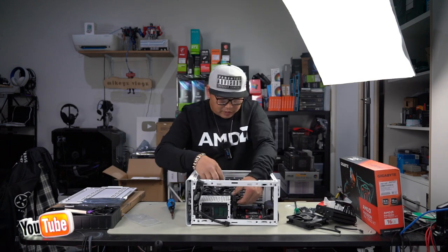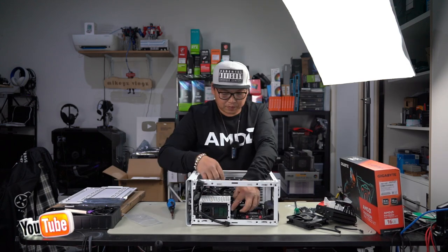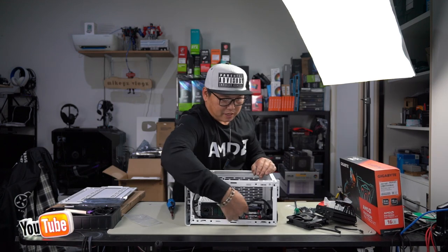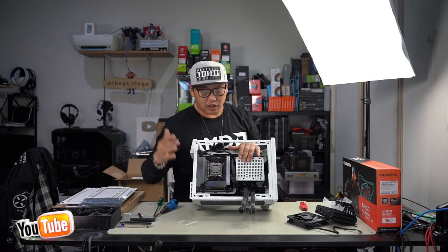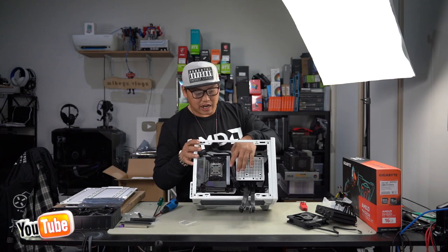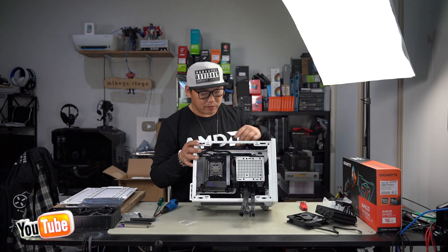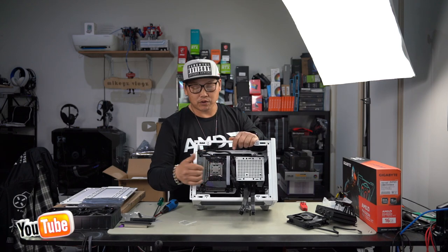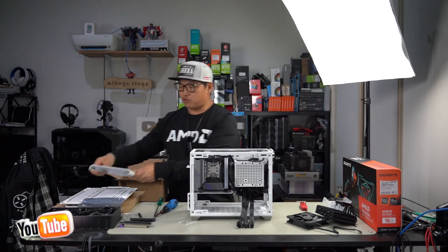That's plugged in. Go ahead and use your Velcros here to tidy up your cables here. All right, here's our CPU cable. Honestly, this just made it a lot easier. So I do strongly recommend, if you're going to be using an air cooler for this, wait until you have installed the power supply, as well as plugged in all your front panel cable, CPU cable, ATX cable. Then after that, go ahead and install your CPU cooler, as you do still have a lot of room for it. You can also remove your front panel that just comes right off like that.